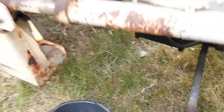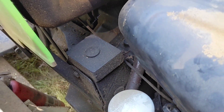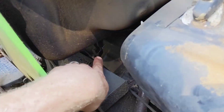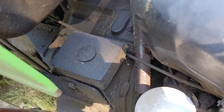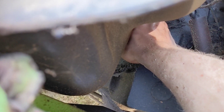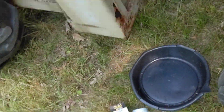Step one: it's a little hard to see, but if you look down there, that's your fuel shutoff on the tank. We definitely want to get that turned off before we get going — it would be a bad surprise if we didn't. So that's shut. Don't need to go super tight; it's a needle valve on the petcock there, so don't go super tight.